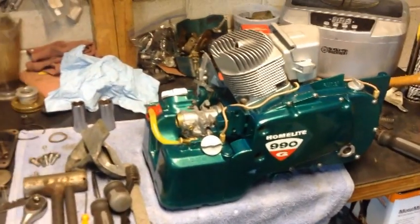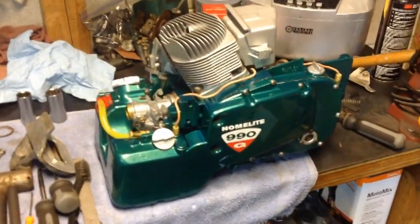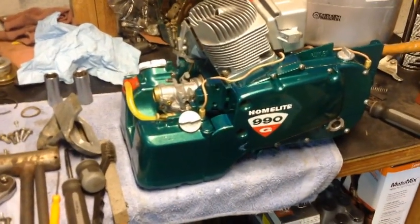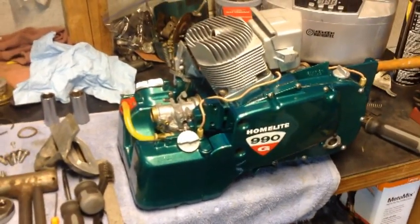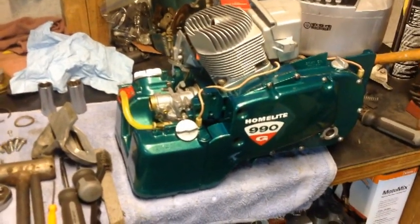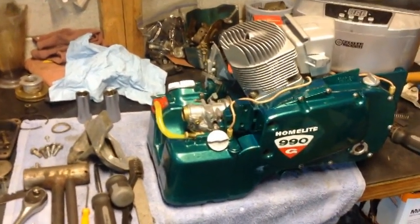You can govern these way, way down depending on spring tension and how much you adjust this up or down. Right now I'd bet this saw is probably running a max speed of 6,000 RPM — I think it's set right where it needed to be from the factory. I may just go ahead and tighten the governor down a little bit more, but we'll see.